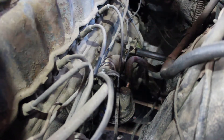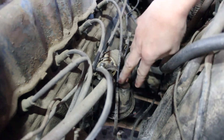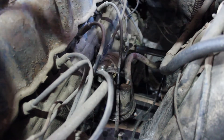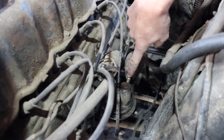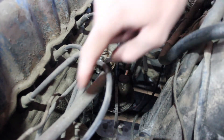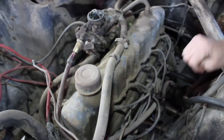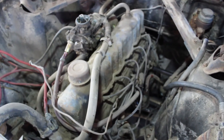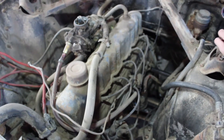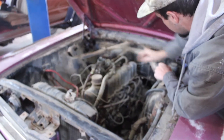The main thing I'm concerned about is throwing 20-year-old fuel and pushing it through the lines. Here's the fuel pump right here attached to the engine — it's a manual fuel pump. As the engine cranks, this thing has a diaphragm that pushes fuel; it sucks it from the tank and shoves it into the carb. We're disconnecting the inlet line and I'm going to run another tube from here into just a plastic gas tank. It's going to get sucked out here, and I'm going to replace the line that goes to the carb with a clear line, and I'm going to put my own in-line fuel filter because they're $5, so it's not going to hurt to just throw one on there to make sure we're not sucking any crud through there. That'll take care of the fuel and get us fuel to the carb.